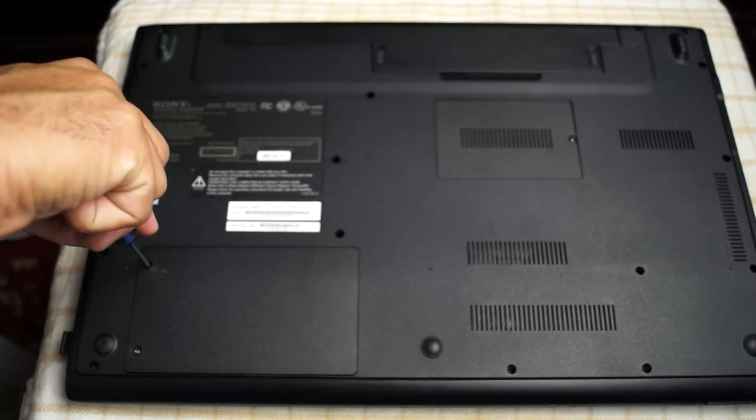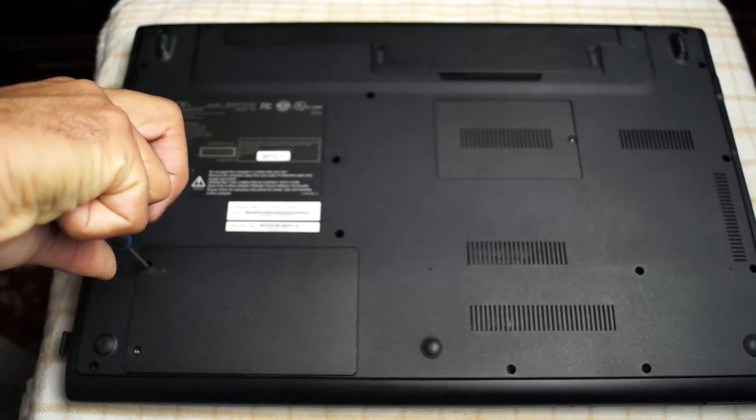Once you're finished that, you replace the hard drive itself. Once the software is finished cloning the hard drive, it's going to shut down. This is where you actually have to physically take your SSD and replace it with the hard drive. Now, different laptops have a different process — my laptop is pretty easy.